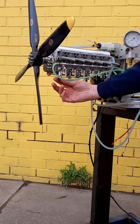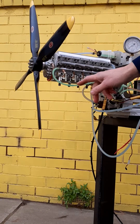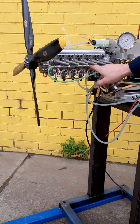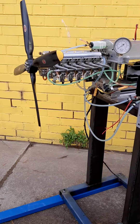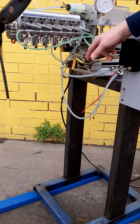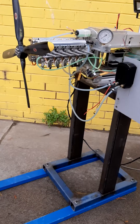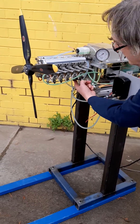It's normally aspirated by the six carburetors seen here. The fuel mixture is controlled by your radio controls, and the fuel is fed by this fuel line and pressurized by an electric fuel pump here. Starting is easy with its own electric starter mounted underneath.